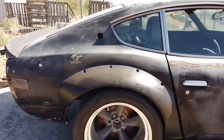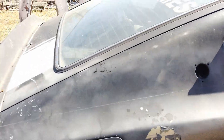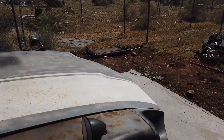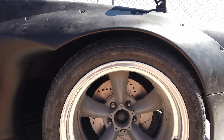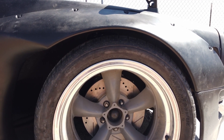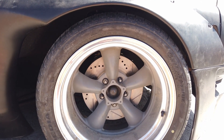It's all set up and I'm pretty happy with it. This is what I started with — it's not even a camber plate, just a back plate for the Neon strut. I cut it down and put three studs in. Using my crude measurement methods, I'm getting anywhere between six on the low end to eight degrees of caster. These spindles are designed for OEM seven degrees of caster — say for example a 2012 Boss 302 with about two degrees of camber — so I'm right around there.